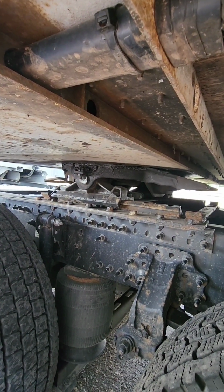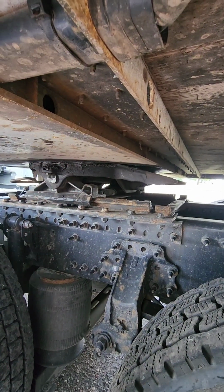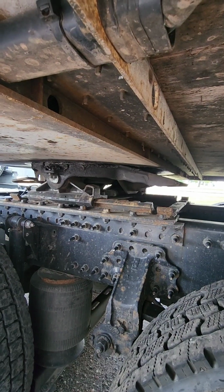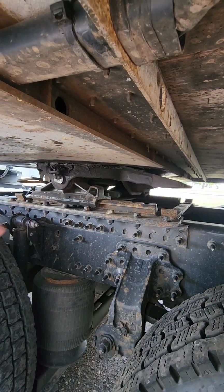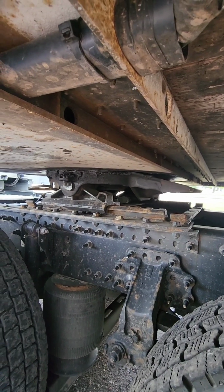For our fifth wheel pins, they're on the inside on this fifth wheel. So you're going to check from the back side, make sure they're properly secure, and they're actually locked onto the teeth on the tractor. All right, moving on to our semi-trailer.